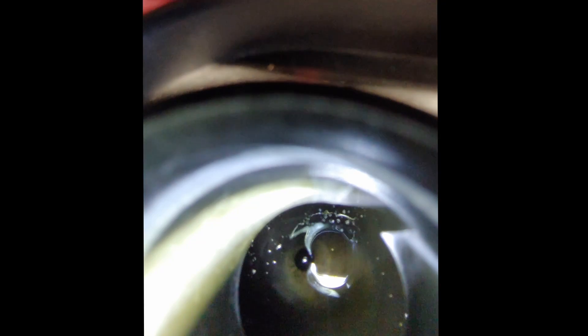First thing I'm going to do is flush the whole fuel system out with the hose until I don't see any more of this gunky buildup in there. And then go from there, probably rebuild the carburetor before I fill it up and see what happens. I've got a spark checker too. I'm going to throw that on there and hopefully that'll be it. If it's not, we'll move on from there. But if it is, I'll definitely change the oil because that looks like molasses right now.